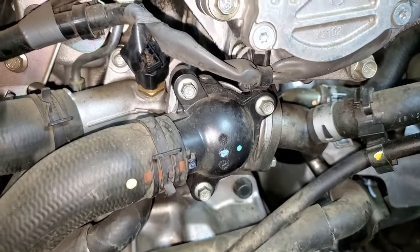We're going to be using the FL22 Genuine Mazda Coolant. The reason is that we do have some coolant still left in the system — we removed the water pump so we got most of the coolant out of the block, and we drained the radiator, but some coolant remains in the jackets. We don't want to be mixing aftermarket coolant with this coolant because there could be a chance of non-compatibility. So to safeguard against that, it's not much more expensive to get the genuine Mazda coolant, ensuring no issues arise from mixing two different types of coolants.